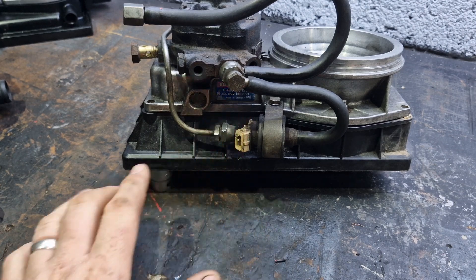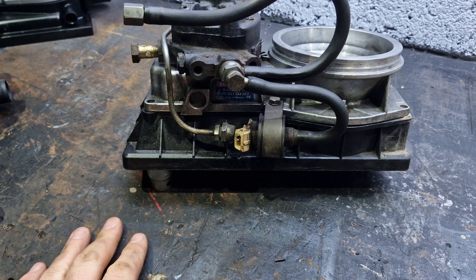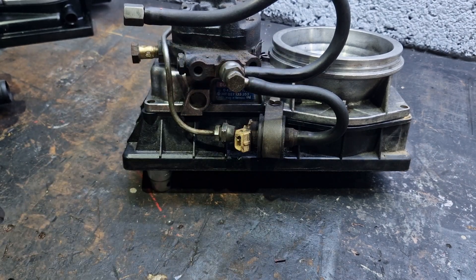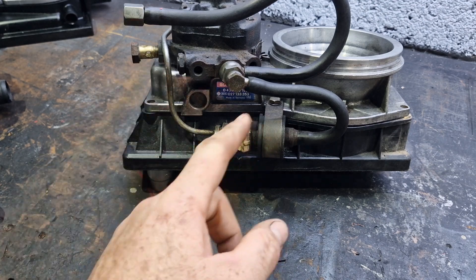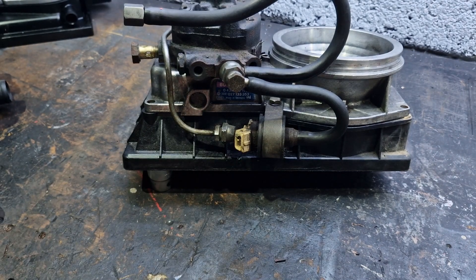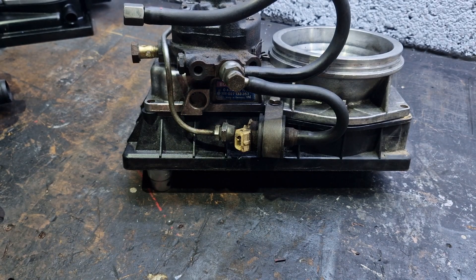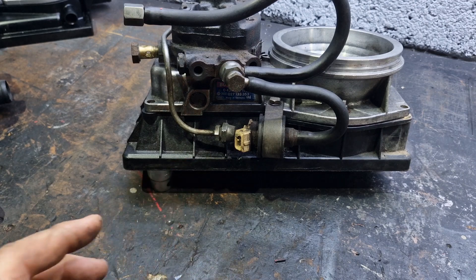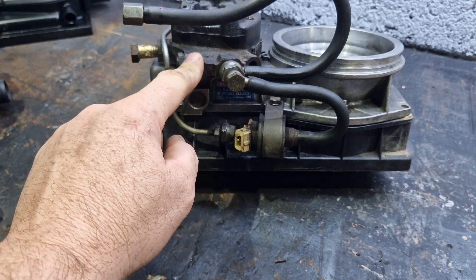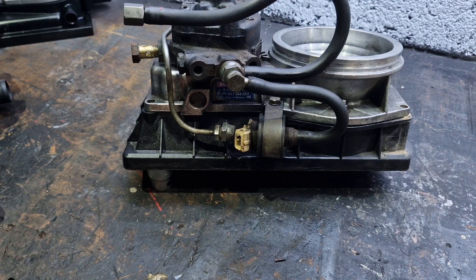The car is happy — it keeps doing this on a continuous dwell period with feedback from the sensor. If you're always getting a reading higher than book figures from the Lambda feedback, that points to something blocking flow, like a clogged cat, which is constantly causing this valve to lower system pressure and add more fuel. That works as a compensation, but it is a sticking plaster over the real fault.